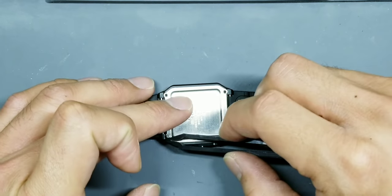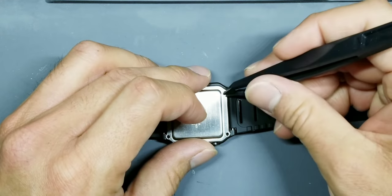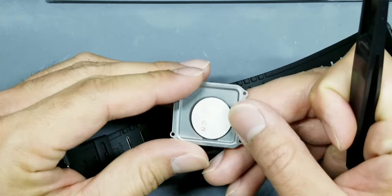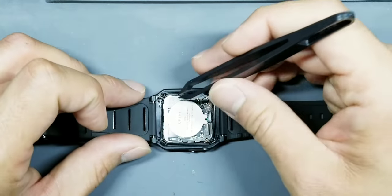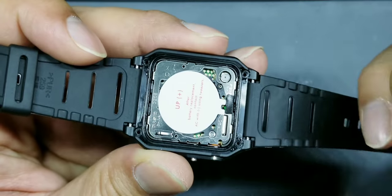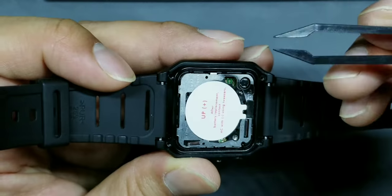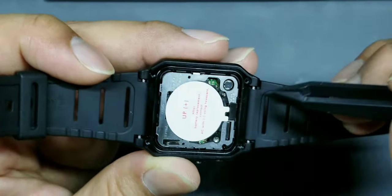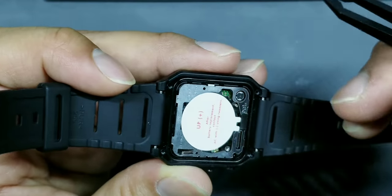Probably no adhesive needed for this project — I've worked on the green one of these before so I'm assuming it's going to be the same, which makes it more convenient. We're going to lift up on the case back. There's your speaker, that circle there, and then the inside is the module. You'll also have the o-ring around here. This is a brand new watch — if the o-ring has a nice glisten in the light, that tells you it's already been lubricated. If it's dry on a used watch, take some 100% silicone oil, take the o-ring out, and put it back in.